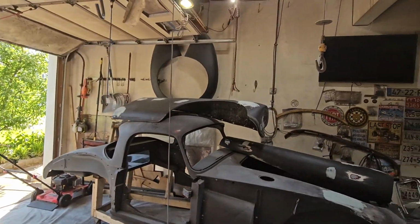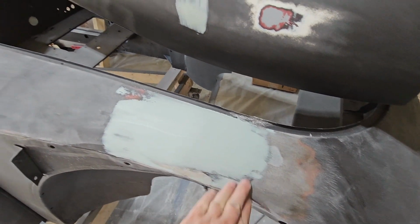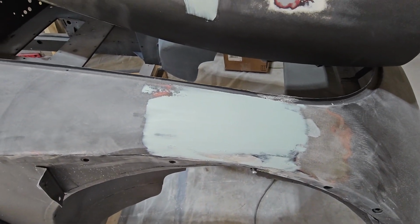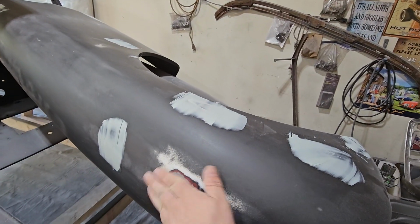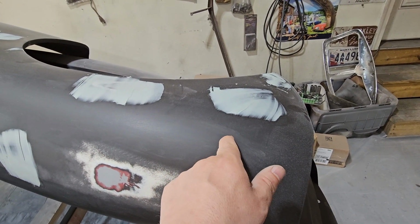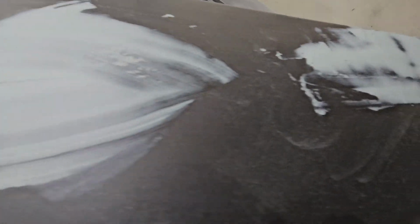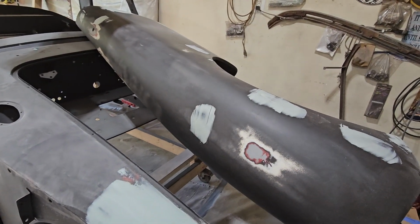Okay, I've now gotten into the fenders and I'm finishing off this. This is smooth and nice, but again, some pinprick holes and some imperfections that I'm working on. So the imperfections are tiny, and that's going to be bondoed out, right? Fender, no big deal. I sanded out some low spots. See another one there. That'll be probably bondoed in. And then again, I'm producing these things as I'm sanding things down, and I'm filling them with Bondo. Okay. It's a fiberglass fender, so no big deal.